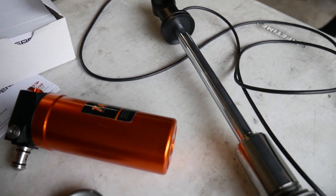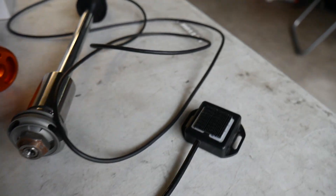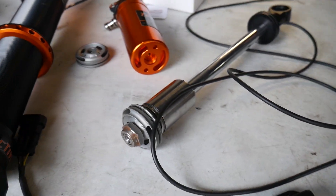Could you employ this sort of technology in something with more significant bumps, like an off-road race car? Yes, we are currently looking at using these dampers in gravel rallying. We're successfully using them in tarmac rallying and have had a lot of success at Targa Tasmania this year with a few clients. In off-road you could use these over longer travel, although that hasn't been an area that's been developed. However, motocross is a huge area where Tractive Suspension is very successful — large travel and lots of high forces.